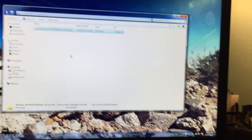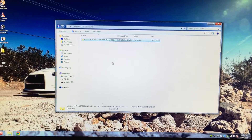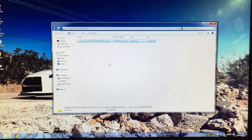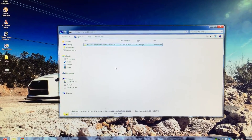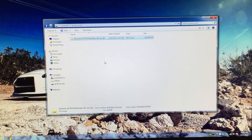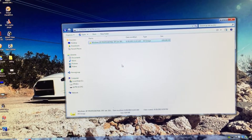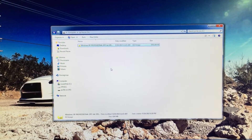Now when I connect this into Linux Mint, it will automatically pop up and show the ISO. I right-click on it and the first option says burn using file burner or something. But you pretty much need a blank DVD. I put in the blank DVD, selected this ISO image in Linux Mint's operating system, and I was able to burn the ISO image onto the DVD. Once that happened, I restarted the computer, pressed F9 to get into my boot options, and I was able to boot off of the internal CD/DVD-ROM. And it worked perfectly fine.